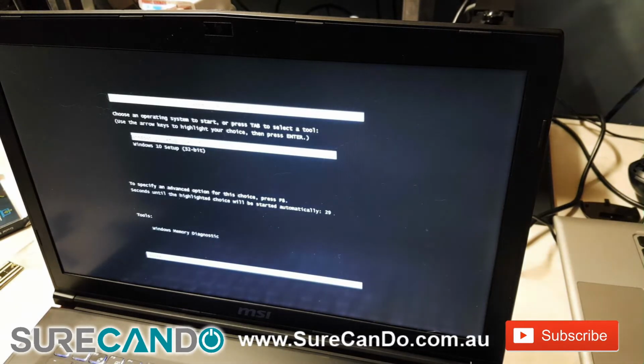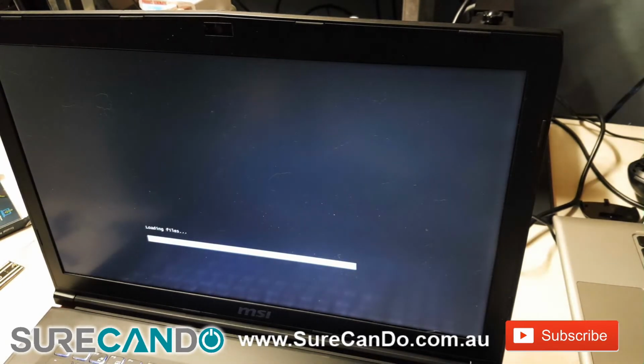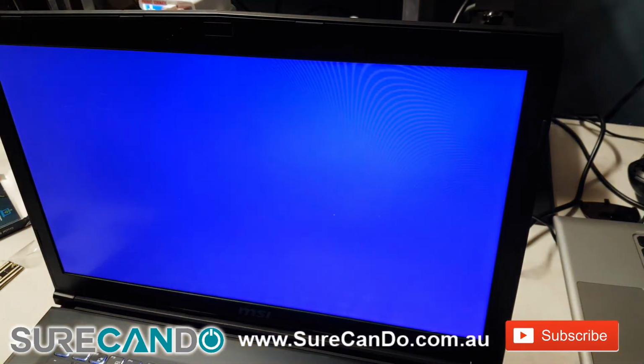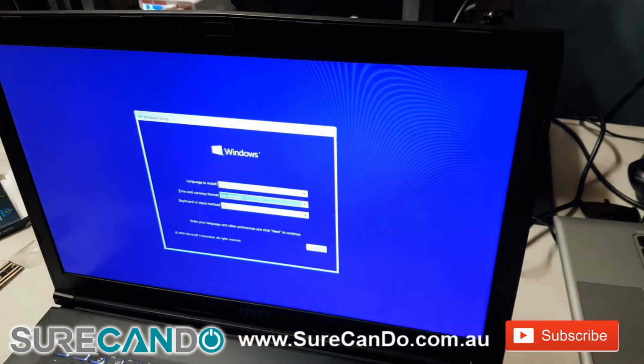And if your USB is not UEFI enabled, you will not be able to boot like this. You will need to go back to BIOS and change the boot type from UEFI to UEFI CSM or Legacy, one of the two. Here we go, Windows 10 setup.